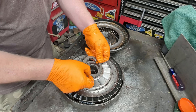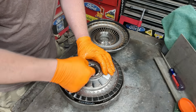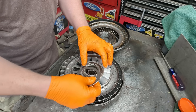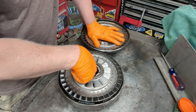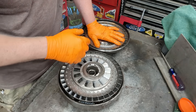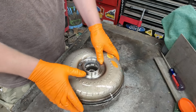Fluid gets pumped in, but anything coming out of the torque converter just goes into the pan. For the most part, most fluid stays in the torque converter with very little added — other than when it goes into lock-up mode, when more fluid is pushed in. It's kind of cool just to see the inside of one of these.